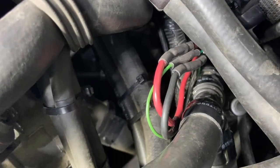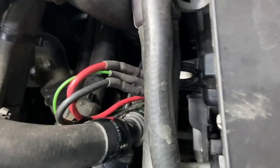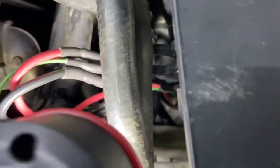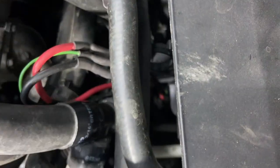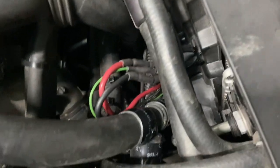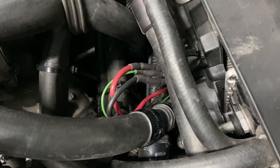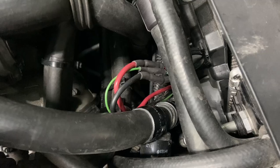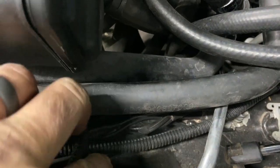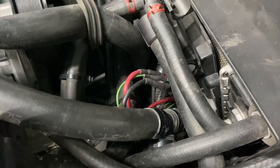These are the crimped and heat-shrunk wires that now run down to the bottom. I've routed the wires properly in the factory location, and the old connector plug is gone. I added about 6 to 8 inches to the length so it's accessible for future servicing — if I have to cut a connector out and service it, I can. I despise this GM loom, but I'm going to loom it up, tie it up nicely, and put this back together, then we'll get to testing.